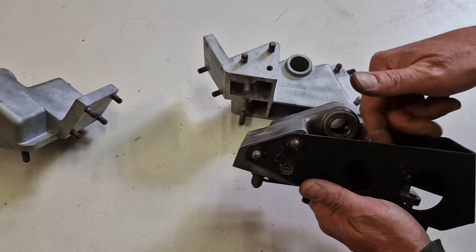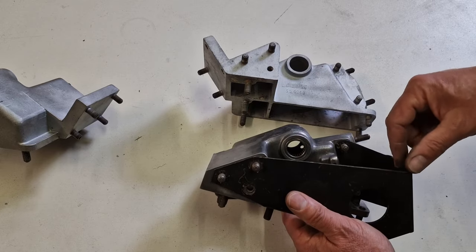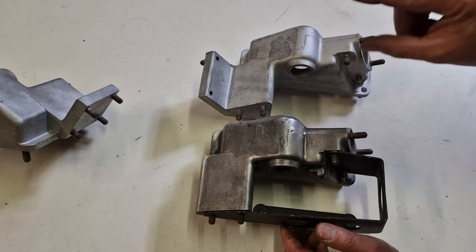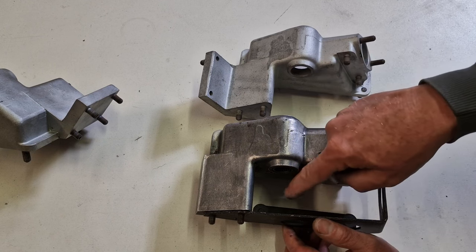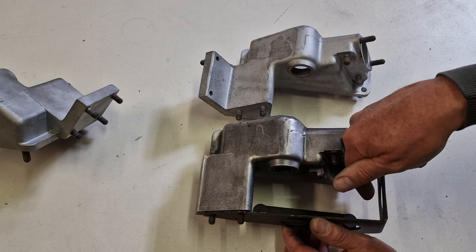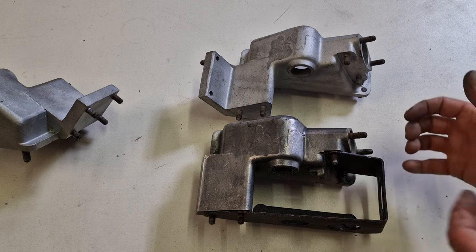And this one was then moved with a special lever and a special pedal, and that was kind of an improvement, but still maybe too many components, and that is why this one only lasted about a year. So remember, this one had the big bellows sitting with the two double brake masters, one over the other. This one had a tandem. There were still two circuits, but I think it had two pistons, or one main master cylinder, and then it all went down to the brake booster, which was a big round thing mounted at the bulkhead.